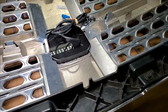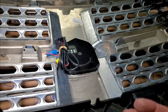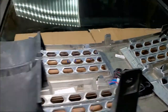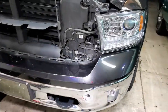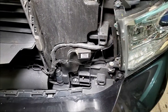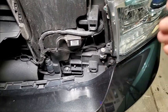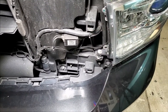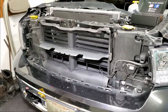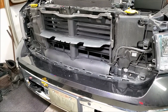If you do see it coming off, not a big deal — just disconnect it, pull the grill off, do what you need to do. One thing I'm going to recommend: this is set up to be hardwired, but I'm going to put a two-prong plug on it because this grill does have to come off if you need to get into your vehicle to change lights. It's a lot easier — you don't have to remove that whole grill just to get to one bolt to get the headlight assembly out. You can go in with extensions. So that's what the grill looks like when it's off, and we'll get to putting those locks on the back and wiring this thing up.